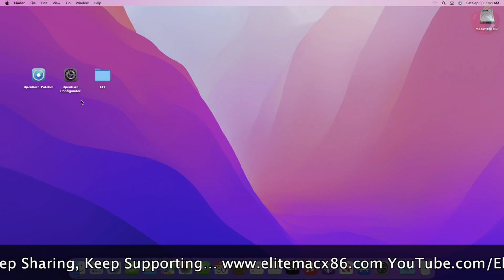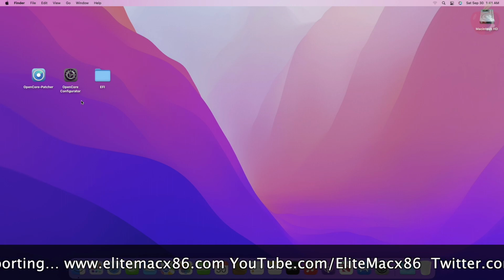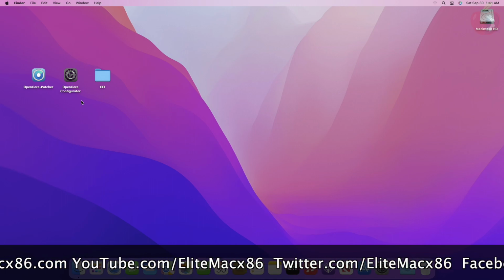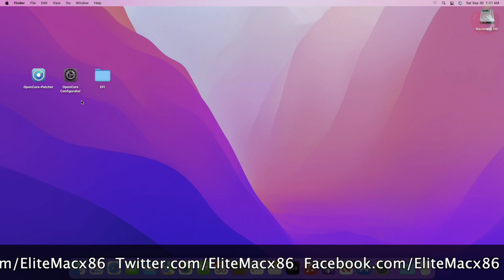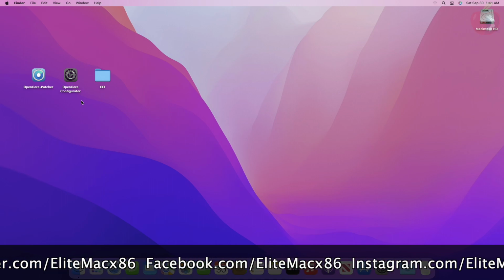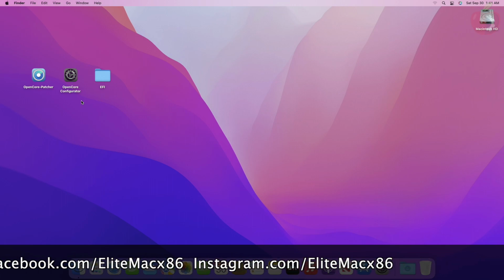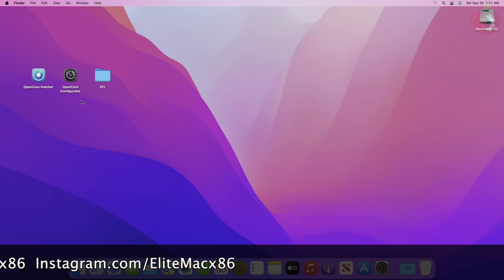Before going further, make sure that your hardware is compatible. To know about the hardware compatibility list, please check out our forum. Also, as you might already know, on Hackintosh Broadcom Wi-Fi is generally preferred for native Wi-Fi and BT function, such as FENVI T919, BCM94360NG, BCM94352Z, etc. However, since the release of macOS Sonoma, Apple has removed support for all unsoldered Broadcom Wi-Fi, so if you have any of such models, the Wi-Fi will not work as of now, but a guide will be published very soon for Broadcom Wi-Fi support on macOS Sonoma.